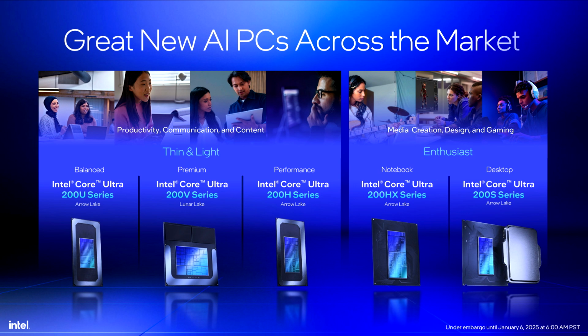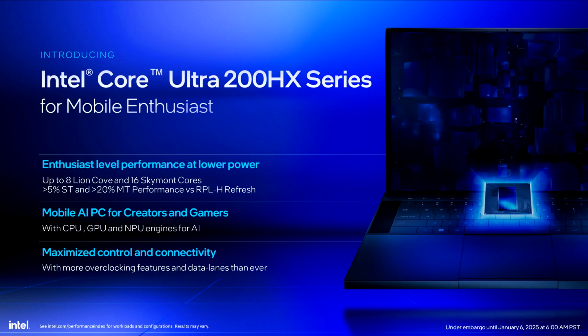All Intel Core Ultra 200HX CPUs feature PCIe Gen 5 and PCIe Gen 4 lanes with dual integrated TB 4.0 ports and support discrete Thunderbolt 5 capabilities. For memory, the CPUs support standard DDR5 6400 SO-DIMMs, or OEMs can select between the faster LPDDR5X or LPCAMM2 memory modules. Laptops featuring these chips can go up to 192 GB of memory, and the base power for each chip is rated at 55 watts with the MTP, maximum turbo power, suggested at 160 watts. As for performance, the HX chips will offer over 5% single-thread and over 20% multi-thread uplift versus the Raptor Lake HX refresh CPUs, while offering up to 13 TOPS of NPU performance.